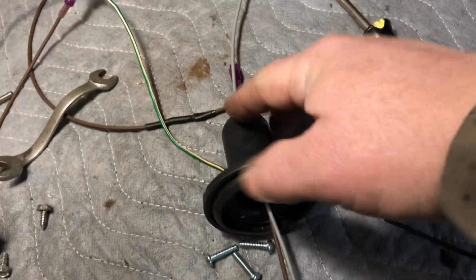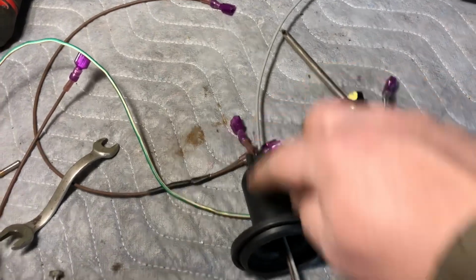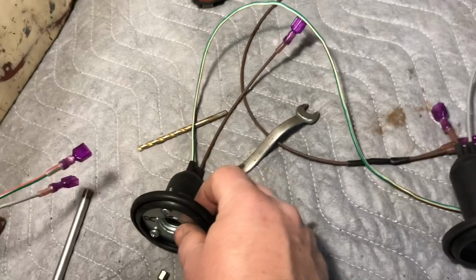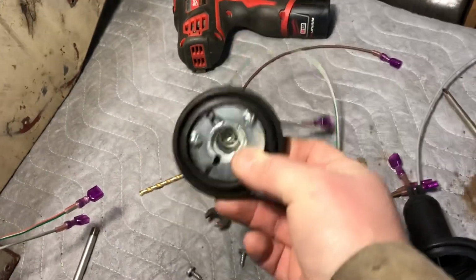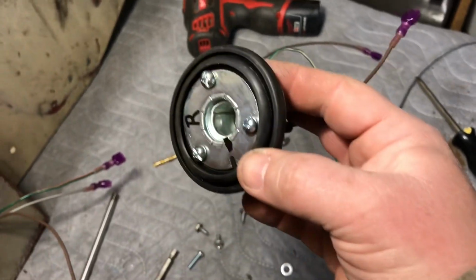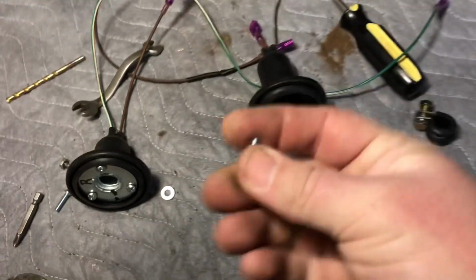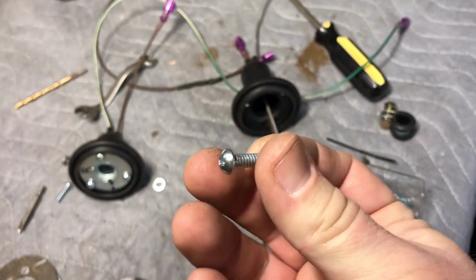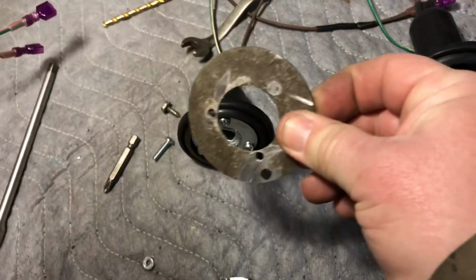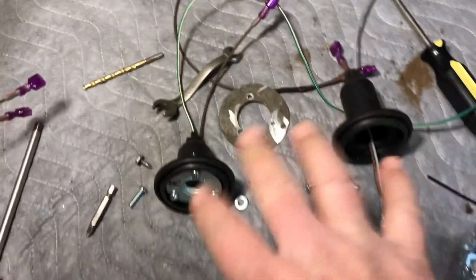So now the rubber boot, then I put on the connectors on the end, and then I crimped them on after I put the rubber boot on, which is very important. So you can see here, then you just pull your wires through and there's your socket. And what I'm going to be using instead of sheet metal screws or anything, I'm using number 10 bolts. Bolt and nut on the back. Just number 10s, regular bolts. And then you got your cover plate in the back. So, okay, that's done. These ones are all done. All 4 of them are done.